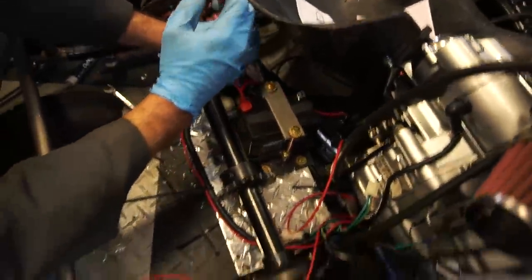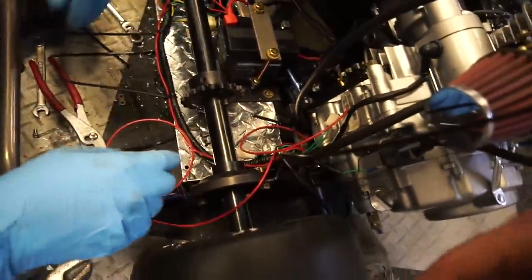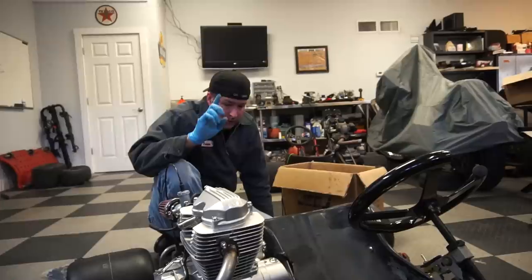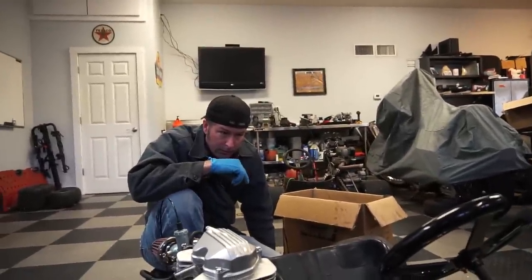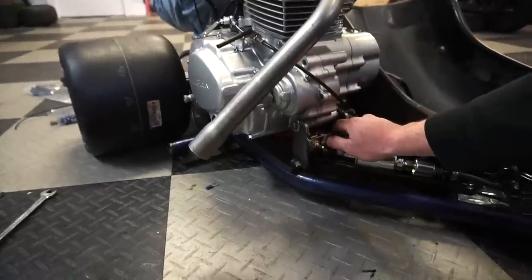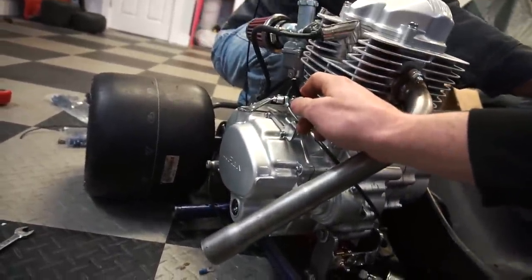We took the wires fed from the switches — one going to the starter relay and one going to the battery. We're piggybacking one to the battery for testing purposes. We got gas in it. Switch on — ignition. Fuel pump's on. Turn on the fuel pump — oh, we're losing fuel out of the carburetor! All right, cut it off.